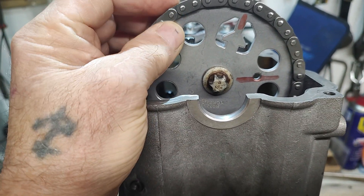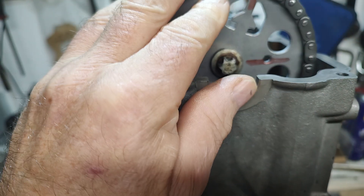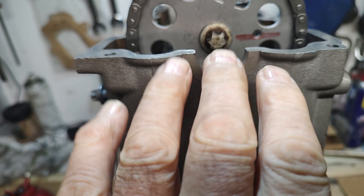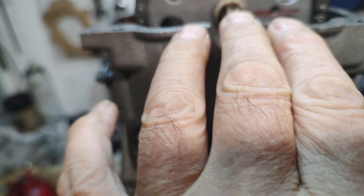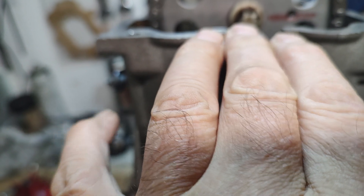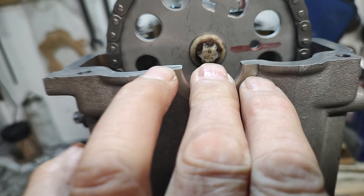It's rocking — if you turn the cam sprocket slightly by hand, you can move it slightly when the chain's not on. You'll see it's just starting to rock on the valve: it's let go of one valve and it's starting to compress the other. There's a little slight free space, and you want to be in that free space.